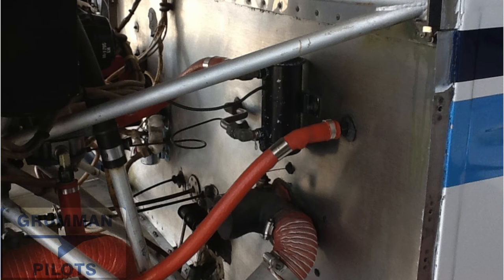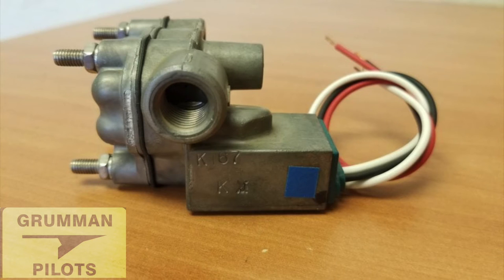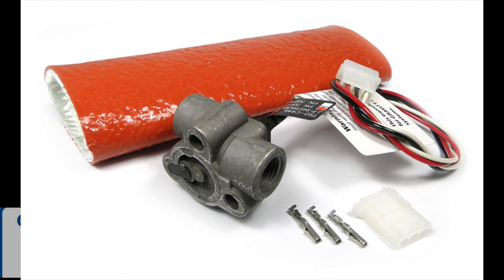After it's all been done correctly, the line coming out of the fuel pump is a nice straight brown line — no turbulent flow. Your fuel flow transducer compatibility isn't limited to one brand: it doesn't matter whether you're using the Digital Pro Scan units — the nice red cube ones used with EI instruments — or the standard flow scans used with JPI equipment. There's a lot of interchangeability there. Getting it all done right gives you a much nicer fuel flow reading.